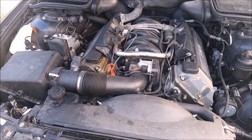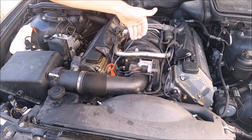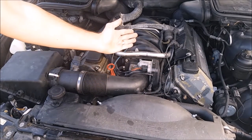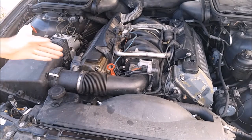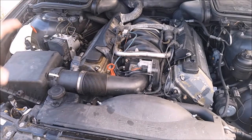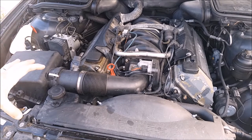If you look at some of the intakes for similar cars — like a Camaro with an LS1 or LS3, or the 5.0 Mustangs — they have this same setup with a throttle body up front, an airbox to one side, and a single tube bringing air in. You've got to give it more airflow than this sharp 90-degree bend allows. So let's get this intake off and I'll go over in a bit more detail how I'm going to improve it.